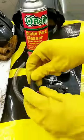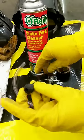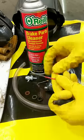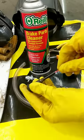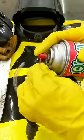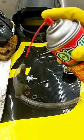Everybody will tell you to use something different. It's a pretty common trick to use a tire valve stem to make the cleaning process easier. Remove the core with a cheap core removal tool, and then wrap the straw for the solvent in electrical tape until it fits very snugly in the tire valve stem. Push the injector nozzle in the valve stem. I'd recommend back flushing first, then put the straw back in the can and you've got your cleaning assembly.